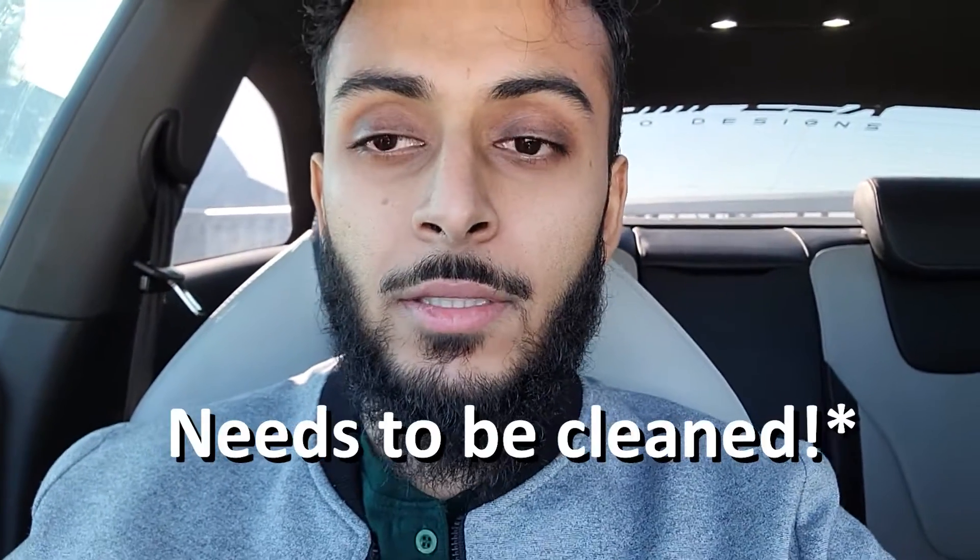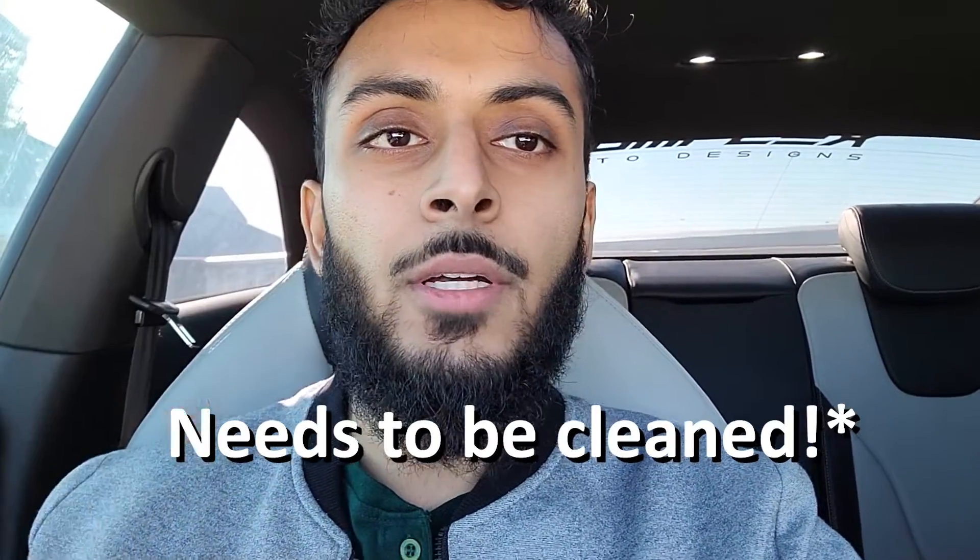Some things you want to keep in mind when it comes to maintenance: a couple of the major ones are the secondary air pump, which tends to go bad — I think there are two banks. If both go, you might get a limp mode. I'm not too sure if that's true, but I did have a light for it at one point and it kind of resolved itself. Currently I just have the check engine light for the O2 sensor, so I still need to grab an O2 spacer. These engines are really reliable and really strong — keep on top of your maintenance. You do want to consider carbon cleaning, like walnut blasting — it gets pretty dirty pretty quick.